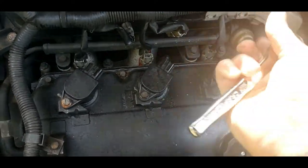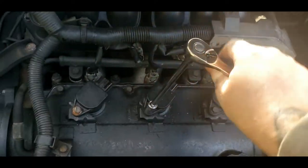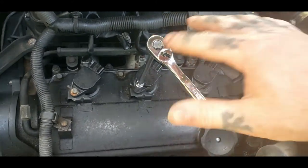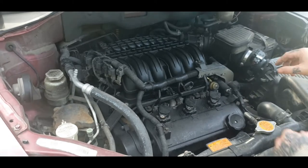Now, you want to disconnect your battery just to be safe. And these coil packs can be quite tight, and I can't break this one-handed, especially with such a long socket because it's trying to tilt. So I'm going to set the camera back down and loosen these out. So once you get your 10 millimeter bolts out of the top of the coils,